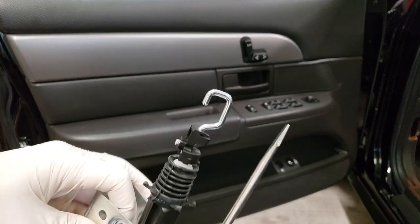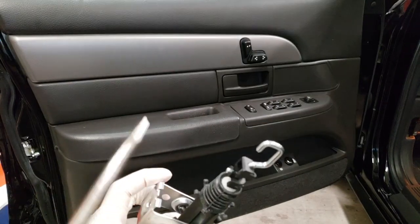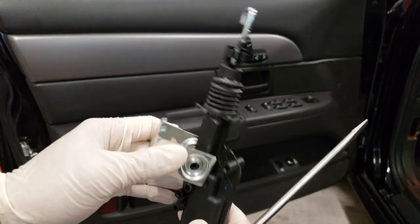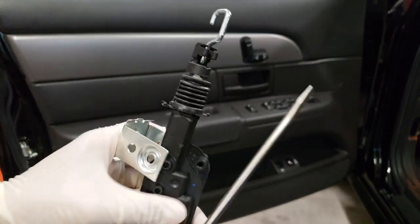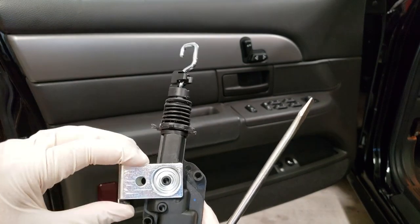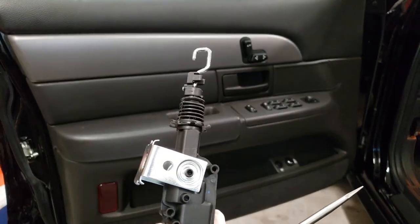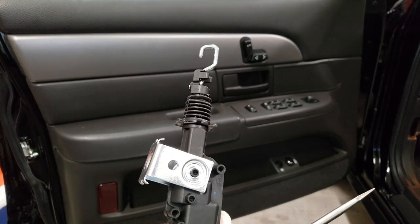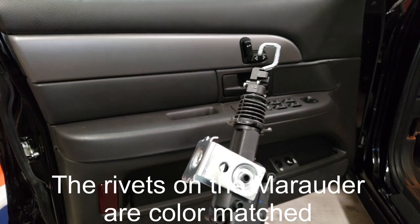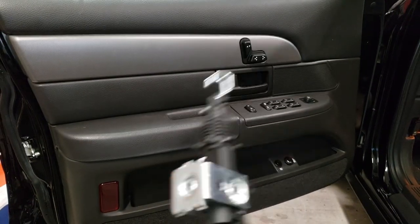When you reinstall you're going to do the opposite. Make sure this direction is correct — trying to go the other way and put this end in first is going to be very difficult to line up that back hole. Instead you want to line up that back hole first, get it in place, and once it slides into place the key is lifting this up while it's there and it slides right in. It saves you a lot of time and stress of worrying about re-riveting the door. So now let's get into the door panel removal so that we can replace this door lock actuator.